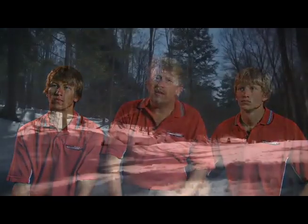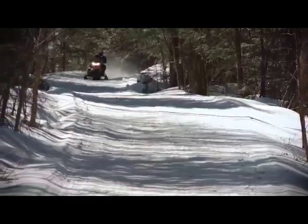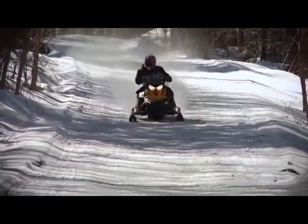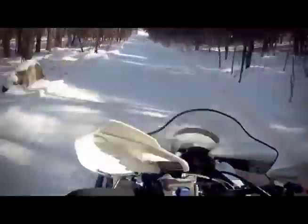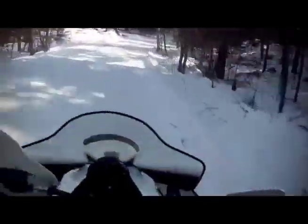Well, let me tell you, the split rail ski, in all my experience in my years in this business, is the best answer to stopping darting. Our snowmobile ski eliminates the darting because of the four rails. So if you're dealing with snow conditions and the snow's soft or has some flexibility, what happens is that the four rails track true and straight. So if one of the rails wants to get into a rut of some kind, three of them compensate for the one trying to do that. That's why it tracks true and straight.